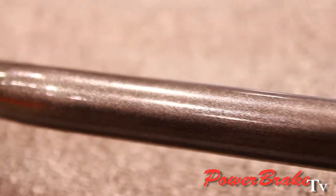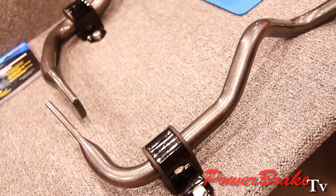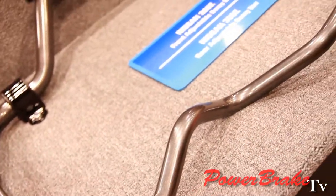All of the sway bars for pro touring applications are tubular to save weight and give you the rate you need to control the vehicle. It doesn't double the strength, but it allows you to run a lighter-weight sway bar — you can get a large-diameter bar without the penalty of the additional weight in the center. The outside of the bar is taking all the torsional loads, so you don't have to carry the center along for the ride, saving weight while getting the handling you need.